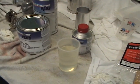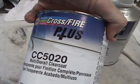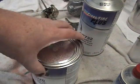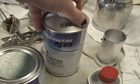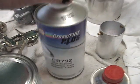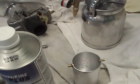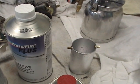So I'll mix in 120 milliliters of the Clearcoat, 32 milliliters of the reducer, and 32 milliliters of the hardener. And we'll put it all in here after I've cleaned out the water, and we'll start to shoot.